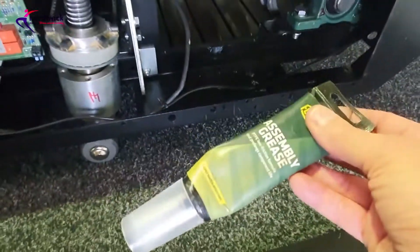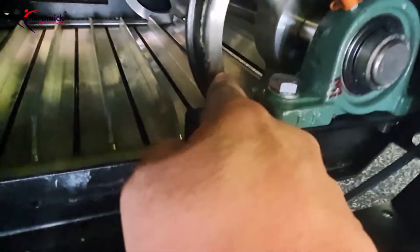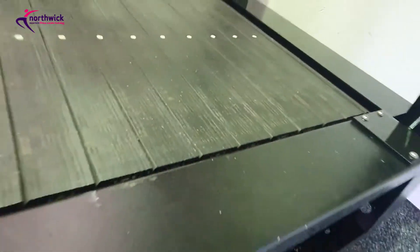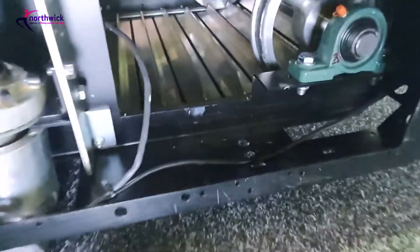There's a little gap where you can see into the belt - check these rubber bands on the edge of the belt and look for horizontal cracks running that way, which indicates the belt is starting to fail. Also apply a little bit of assembly grease - a light wipe on the top surface to keep the belt supple. Be careful of your fingers, and note that you may not be able to move the belt by hand. You'll need to switch the machine on at slow speed. Be very careful if applying lube while the belt's running due to electrical and finger trap hazards.